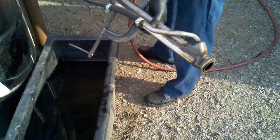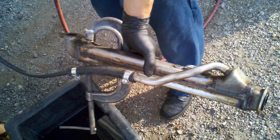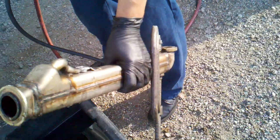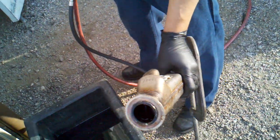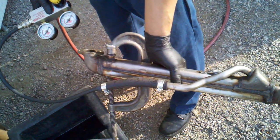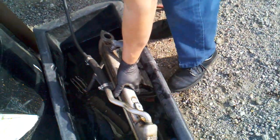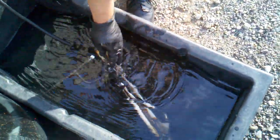Ford 6-liter EGR cooler — one that we've all heard and read about. This one has coolant getting into the EGR system. After it sat for a few days waiting on the Extended Warranty Company to come verify it, it actually hydro-locked the motor. We had to push it in because of the coolant getting past it, so the insurance is going to send an adjuster out to look at it.